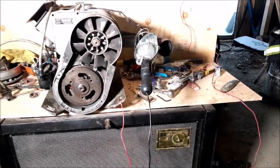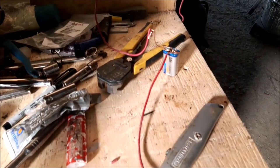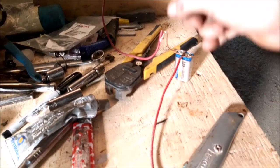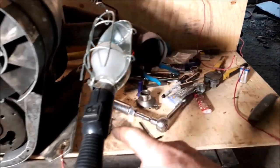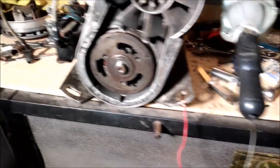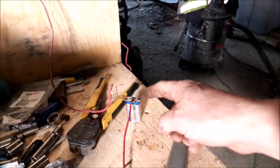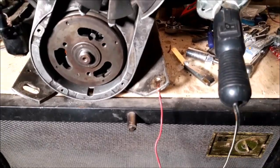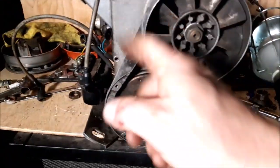As promised, I'll show you exactly how I set this timing light up. I take a 9-volt battery like this — you're better off with a 6-volt battery, but I use a 9-volt; you just can't run it too long with a 9-volt. I have a power wire running from the power side of the battery over to one side of this lamp, and the other side of the lamp cord runs to either the power or ground of the lamp. Then that other one runs to one of the coil wires coming out of the engine. The ground off this side of the battery runs down and I just have it hooked onto the motor mount — so a ground from the battery right to the motor mount.